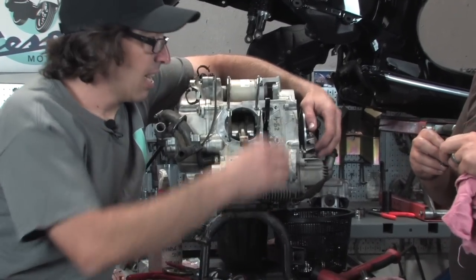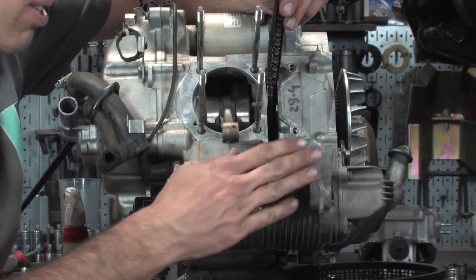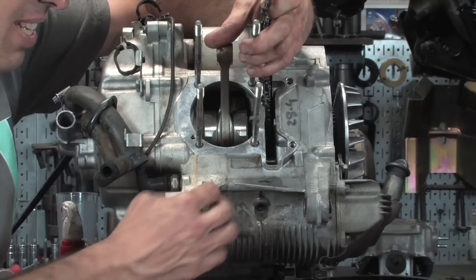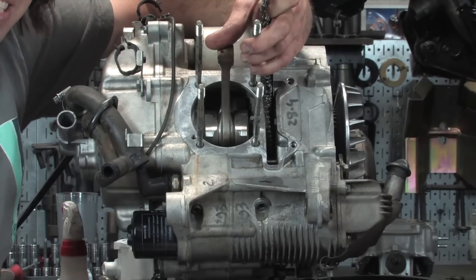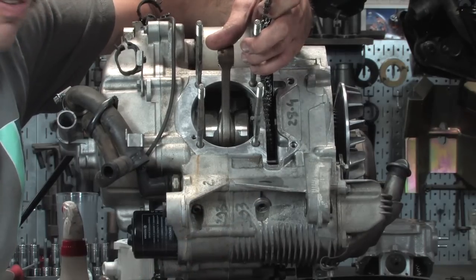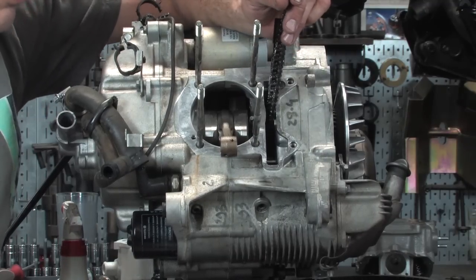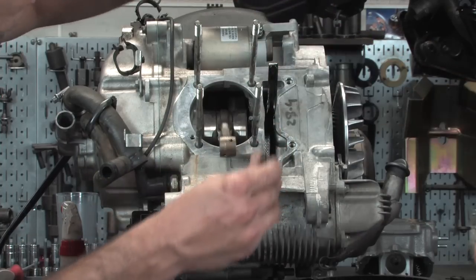Okay, yeah. Basically, if the crankshaft is going to be replaced, there are machining tolerances for the journals in the engine case for the mains, and they separate them into two categories. The funny thing about this engine is it says one on one side and two on the other. I've seen that on a number of Piaggio cases. But most of the time it says one, one. That means it's most likely a category one crankshaft. If it says two, two, category two. Unfortunately, sometimes you see two different numbers. The only way to accurately check is to see what crankshaft is in there, and hopefully it's the correct one for the journals, or completely take the engine apart and measure the journals with a bore gauge. Generally, you just replace it with the same crank that's coming out.